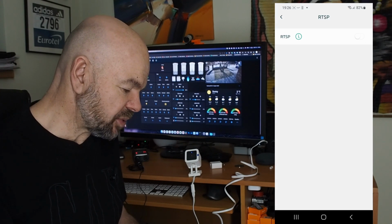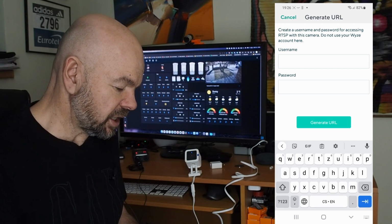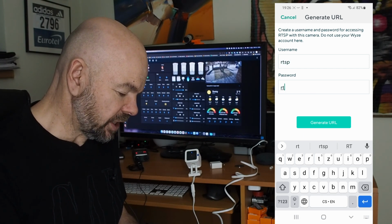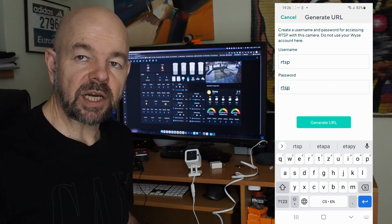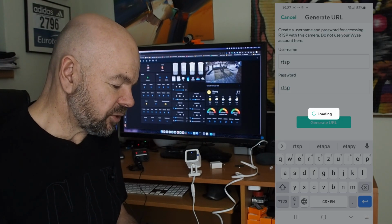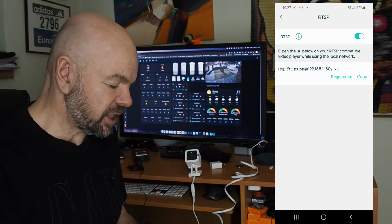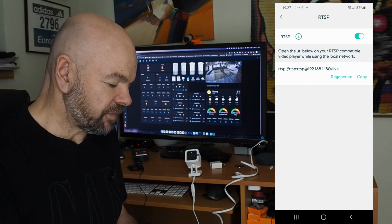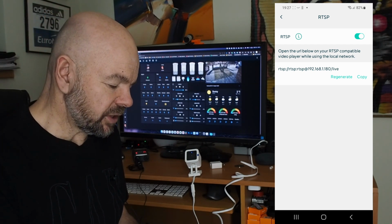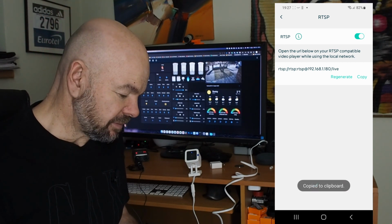So I'm gonna go to RTSP, I'm gonna enable it, and here I'm gonna just enter my username. So I'm gonna just go RTSP for now, and password RTSP. This is obviously not gonna be my username and password, I'm gonna change it. But just for this video, I'm gonna say generate URL, and it created this URL. So there's the IP address of my camera, and there's the username and password in the URL. So I'm gonna just copy that, and I will need to configure it in my Home Assistant.